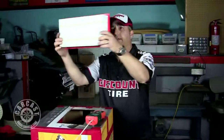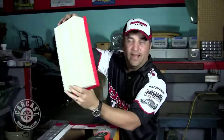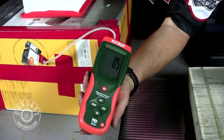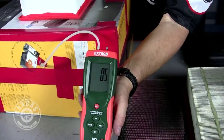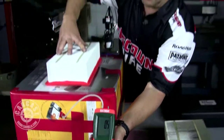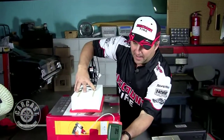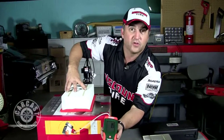Stock filter clean. Like they say, if you can see light through it, it's probably still good. We know this one's good because it's brand new. Around 0.4, 0.5 — so maybe five to six times less reading. Obviously a lot more air is flowing through this because there's less restriction. What's happening is the box inside has a vacuum, and that's essentially what we're measuring.